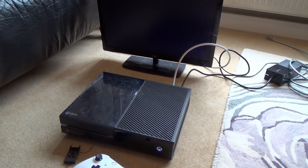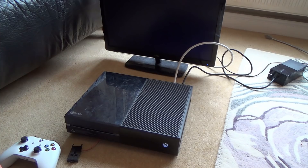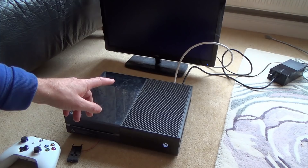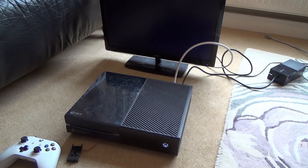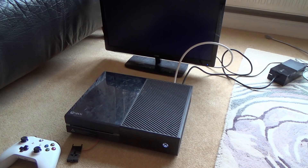My uneducated guess is that I don't think there's anything wrong with the display of the Xbox — I think that's fine. I think the problem is with the operating system. Either the hard drive itself is faulty, but I can't hear any clicking, so I'm thinking maybe it's just got corrupted. Maybe somebody tried to do something to it. So what I'm going to do is take out the hard drive, connect it to my computer, and try to reinstall the Xbox software on there. I can't see any water damage on the inside — it's all very clean, just dusty. It looks like an honest Xbox.